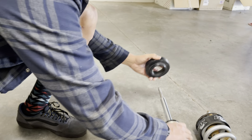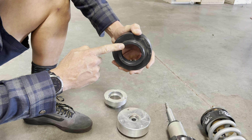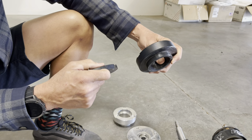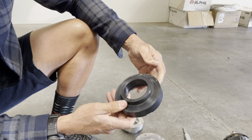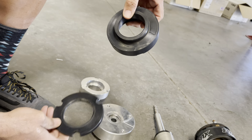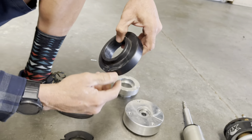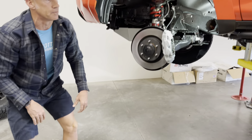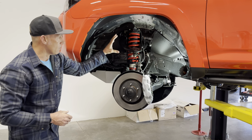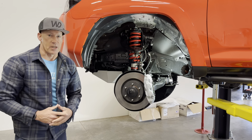This plastic design goes up on top like we discussed, but because the lip is so shallow, at full compression it does not bottom out — it still uses the bump stop. This is honestly the closest design we've found that works without compromising the shock. The downfall is the plastic. This kit was on a vehicle for three months of testing and has already started to change shape. On a vehicle where you've spent sixty to seventy thousand dollars, a hundred and fifty dollar lift kit made of plastic that is subject to heat, cold, and Arizona elements has a real risk of cracking, splitting, or deforming over time.